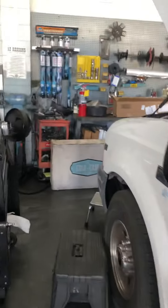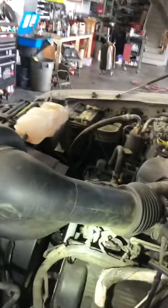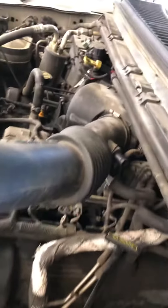Steve over at iFixxum, we got a Ford F-250 Super Duty. A lot of these commonly blow spark plugs out — like a B-17 bomber firing up. This one blew out the number six spark plug; threads are completely gone. This truck has about 300,000 miles, and about a year ago it blew out the number two as well.